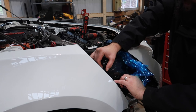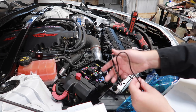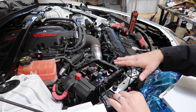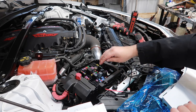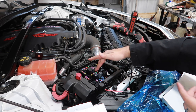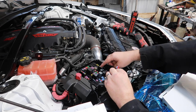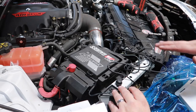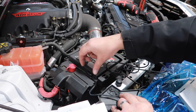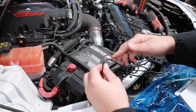Now that our headlight is nicely fastened in place with the new 12-volt hooked into our wiring, we have this little piece that goes into our fuse box. I made a judgment call on which port to use and settled on the 10-amp fuse here — under the lid it says it's for manual headlight level. We pull that one out and plug in the new harness connector to take its place, providing power to our new setup. The fuse box cover goes back on with the wire routed neatly out the corner, and we route the wiring across to the left-hand side, tying up the excess.